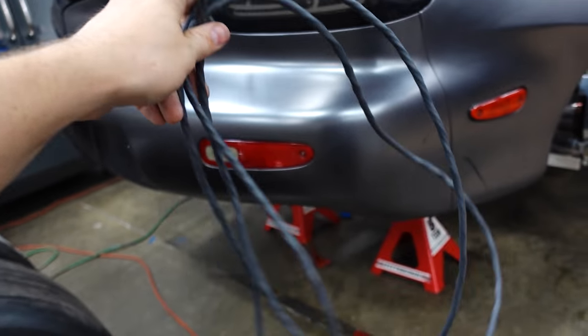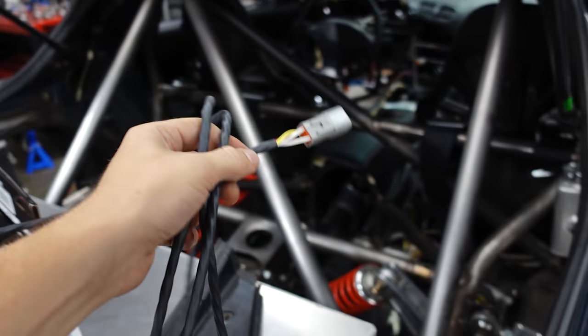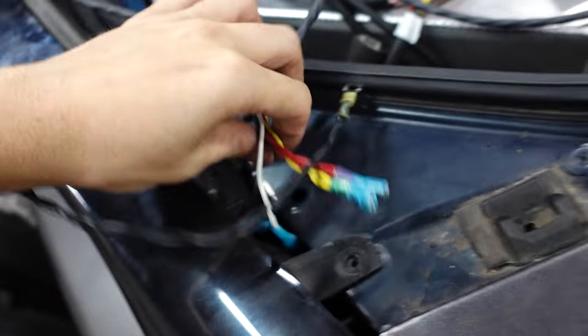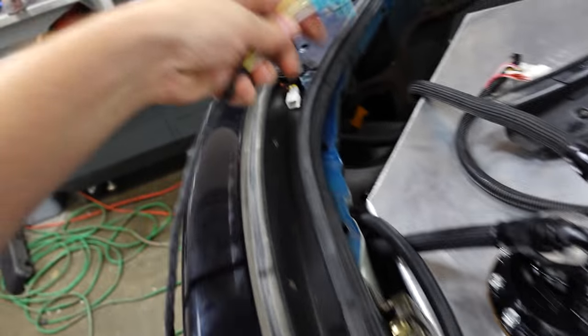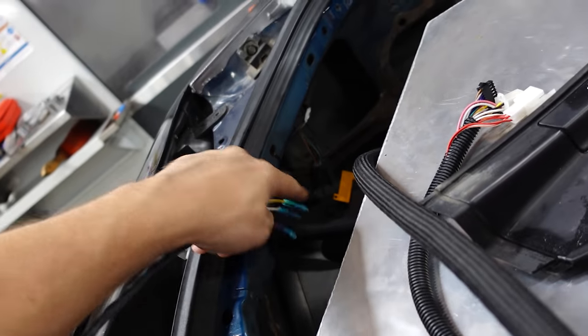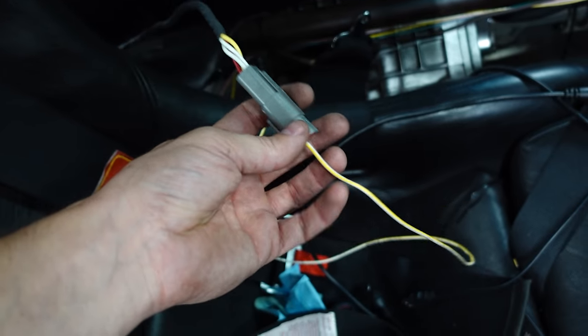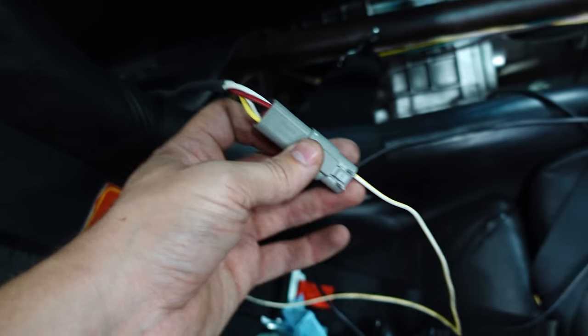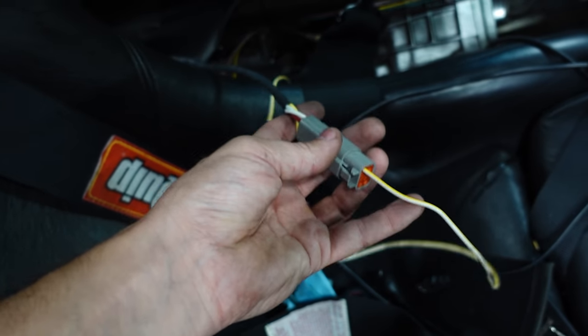The harness turned out pretty decent. I don't know everything we're going to do in the back so I'm going to start with something simple like this. This end is going up toward the front of the car so I want that one to be nicer. It terminates here inside — grounds to the side of the car here — and then this one plugs in right down there. The wire coming from the back of the car is coming from the power distribution — simply enough, just one wire into this side for now until I get running and turn signals working. I want to test turning this circuit on and we should see both tail lights light up.